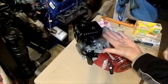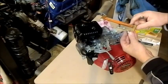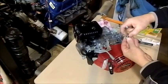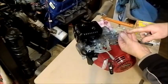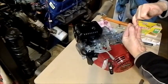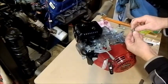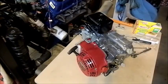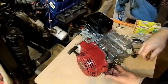If the spanner has a fractional value on it like 3/8 or 7/16, do not use it — this is all metric. When we talk about bolts, a lot of people would think that is a 10mm bolt because the 10mm spanner fits onto it — it's actually a 6mm bolt. Bolts are always referred to by the thread diameter, which is 6mm in this case. This is a 6 by 1.0 — the 1.0 refers to the distance between the peaks of the thread.